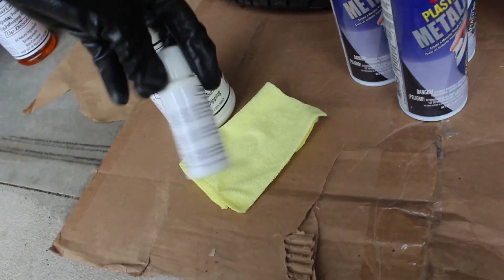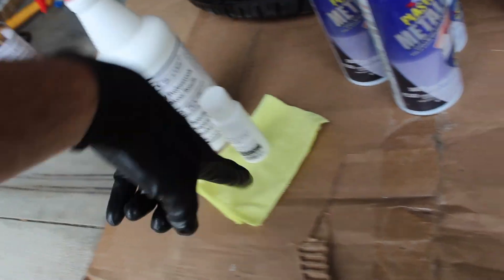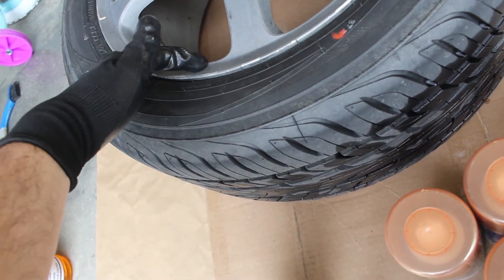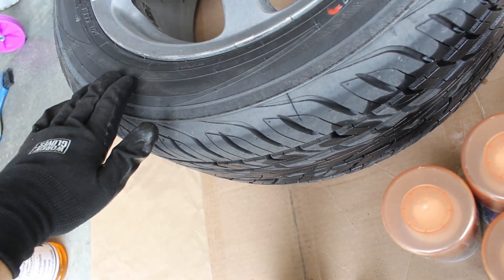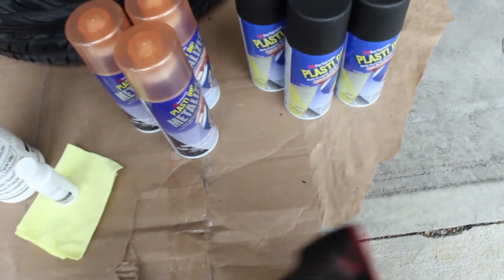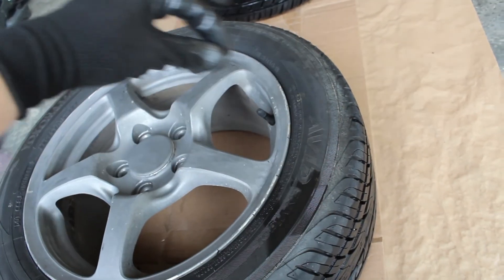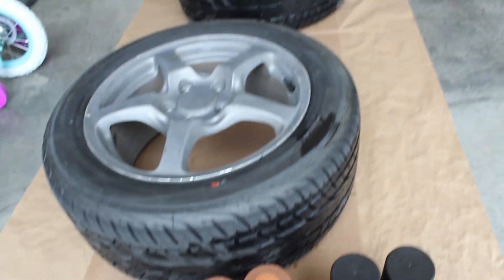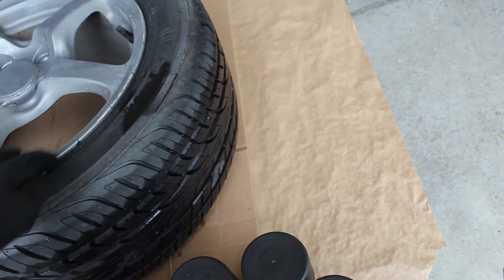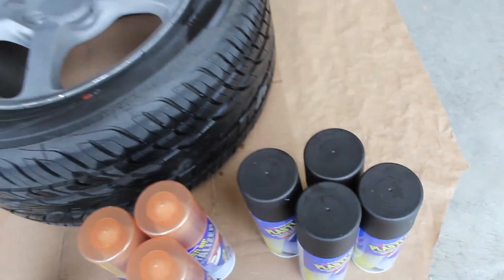Give them a good soapy rinse with some hot water and soap, and then when they're dry, use the pre-dip spray. You spray it on a microfiber towel and just wipe down each part of the wheel, trying to get all the grease and stuff off so that the dip can actually adhere properly. This right here is the dip release agent. What this is - you put this on a little microfiber square and wipe it along the sidewall of the tire. Try not to get it on the actual wheel itself. Just get it rubbed in real good, and what that will do is allow the actual dip to just peel off - you'll get this big ribbon of dip that comes off the tire. It allows you to get a good coating on the outside of the wheel without worrying about masking it off.